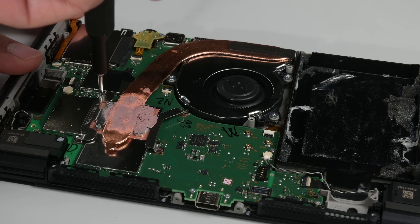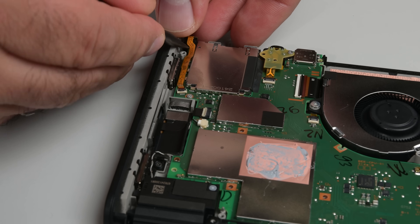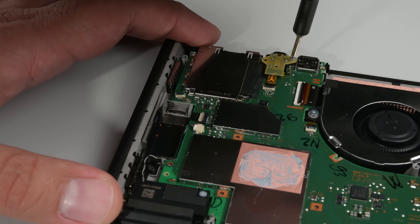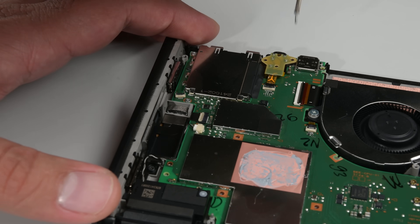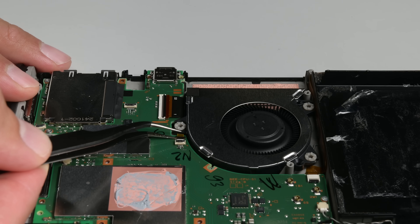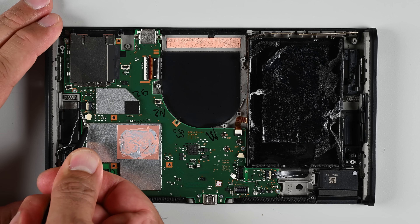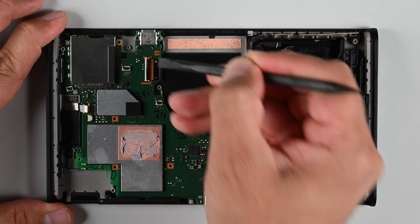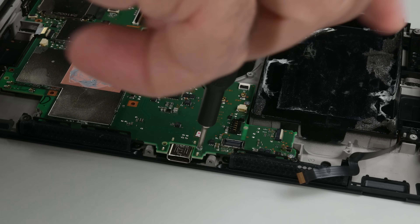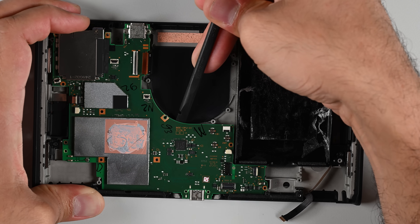This copper heat pipe is calling to me. A few screws and some prying releases the thermal paste adhering the copper to the shield underneath. I then go around the board disconnecting flex cables, starting with a microphone running the height of the device. The headphone jack is an easy target and, like the microSD card reader and microphone, is a single-component module — great news for repairability. The fan is also easily accessible, held by three screws sitting on rubber grommets that help mitigate fan noise. The two speakers are next, pretty easily accessible and connected to the main board by JST-style connectors.